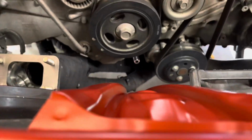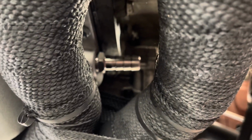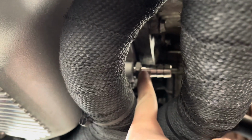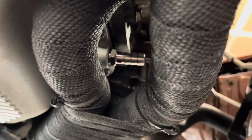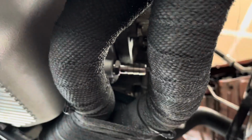You want to talk about clearance? Look at this gasket and this bolt too. Freaking ridiculous. It looks like I'll be able to use this chaseway between the manifold pipes to tighten the hose clamp on there, and if I have to tighten that more, I'll be able to reach it. I was a little concerned about having to take the manifold on and off to test fit the oil drain, but it looks like I'll get away with this tiny work area.